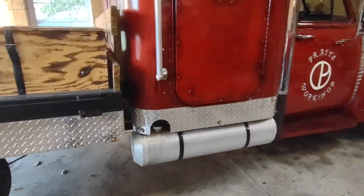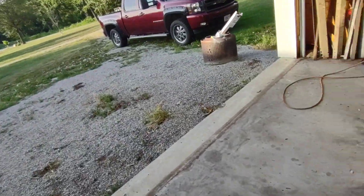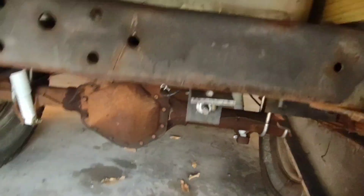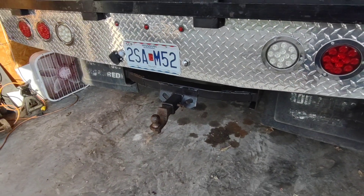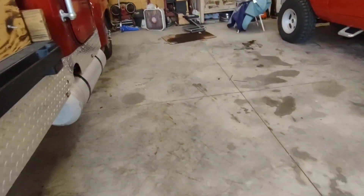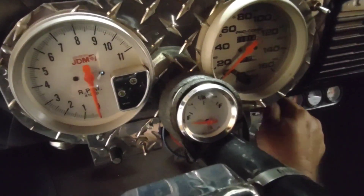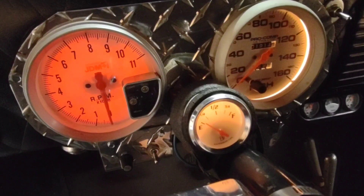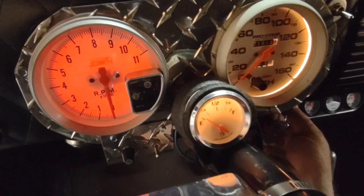The 48 — the last time we were kind of on it, we had done the fuel tank, a new fuel tank in between the frame rails on the back. It's up in there. It's not the best as far as mounting, but I think it'll work. I've got a brand new fuel gauge to go along with the new sending unit in the tank. The fuel gauge I had before was kind of hit and miss — it was a cheap fuel gauge. Now we've got a little better one in here, and it's nice and quiet. The other one ticked whenever you first fired up. So the new fuel gauge has been installed.